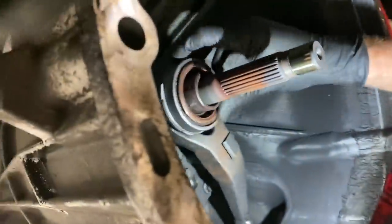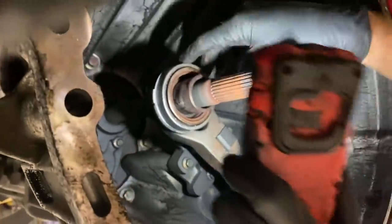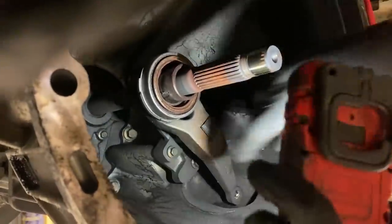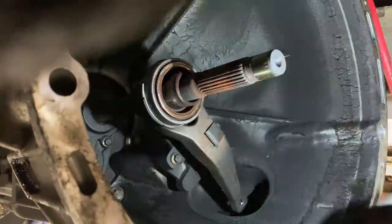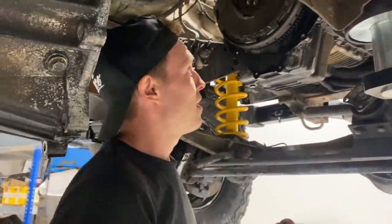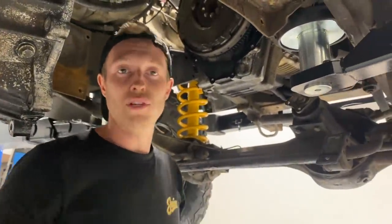We're going to strip all of this down, and then we're also going to change into our gearbox here. Going to change our bearing here, which sounds a little bit dry. Going to change the clips and then the rod holder here, which actually holds the push rod for our clutch slave cylinder. So we're going to strip everything down, re-grease this shaft, build everything up, and then we can bolt everything back together and test it. And then we'll have a lifelong, stronger, heavy-duty clutch.